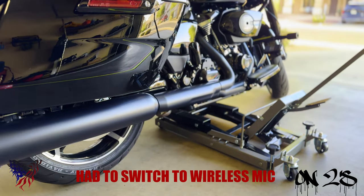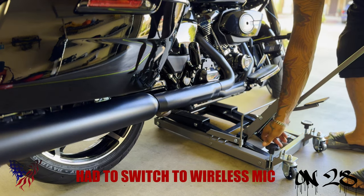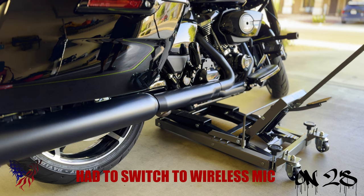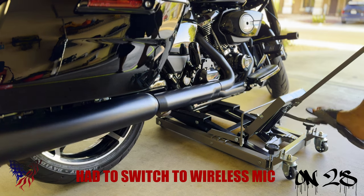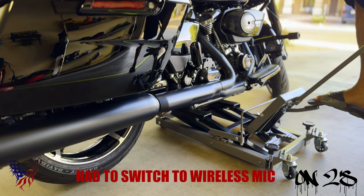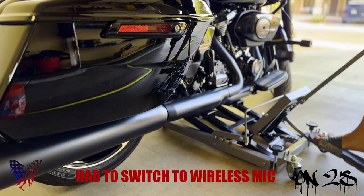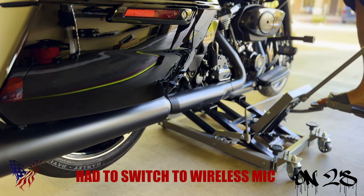You want about an inch and a half on each side just to make sure the bike is balanced on the jack properly. Go on one side and check underneath to make sure. Once you figure out where you want it, go ahead and turn your locks clockwise so they're on the pavement — this keeps the jack from rolling. Double check: I can push it to make some adjustments, but it will not move once you get the bike up.